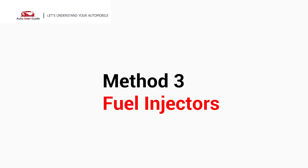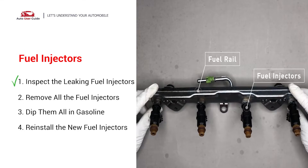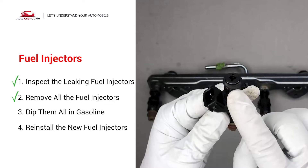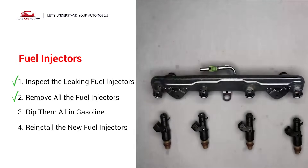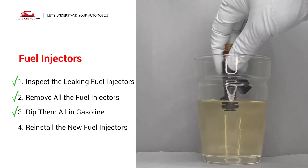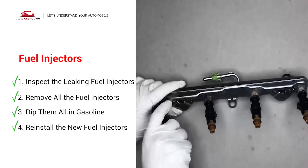Method three: check the fuel injectors. The fuel injectors are mounted in the intake manifold so that they spray fuel directly at the intake valves. Inspect the leaking fuel injectors on the fuel rail and carefully remove the fuel injector. Make sure the new injector has new seals and never reuse the old seals. When you change the fuel injectors, change them all as a set, otherwise the engine will run unevenly. To prevent leaking, get some gasoline, put it in a cup, and dip the new fuel injector into it so the seals get wet with gasoline — it will go in and won't leak. Then slide all the new fuel injectors in.